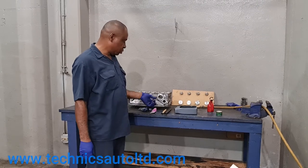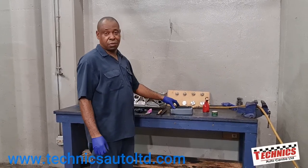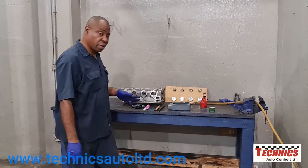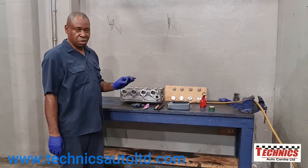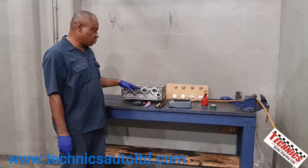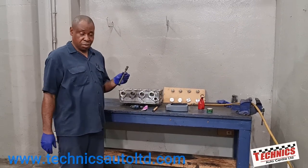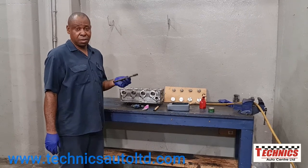We have the valve compound - coarse and fine. We have the valve stick. This is just an oil bottle we cut open to use as a cleaning container with a little bit of gas in it, and we have the oil can. There are many ways to grind the valve and many different tools, but sometimes in this work we like to stick with tradition. While some people prefer to use a drill to grind the valve or buy expensive tools, I prefer to use the valve stick - it's one of the original methods of grinding the valve, and in my opinion it gives you the best finish.